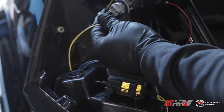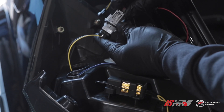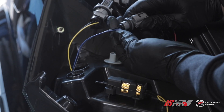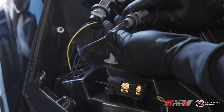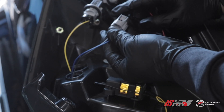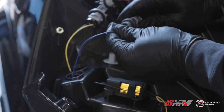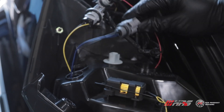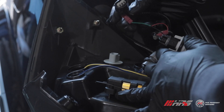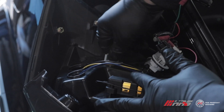The yellow and black wire gets plugged into the gray plug on the car side. The blue and black wire on the tail light gets plugged in right here - it's the only plug that has the correct size for this smaller connector. Plug that in and then you're left with this last plug.